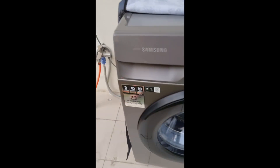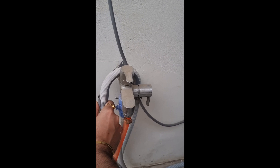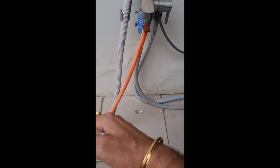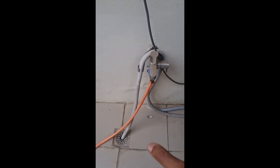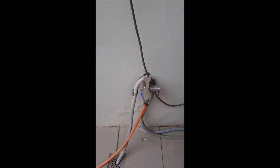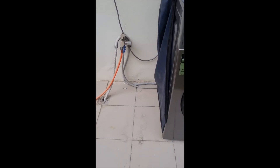There is another thing — you have a drain pipe with a bend in which you put the pipe. You have to keep it elevated and put it in direct drain, because otherwise water will not drain properly and it will go back into the washing machine. Samsung recommends that you place it at a height — in fact, you can drain it up to 8 feet high. If you have the washing machine on the ground floor, you can drain it up to 8 feet of height.